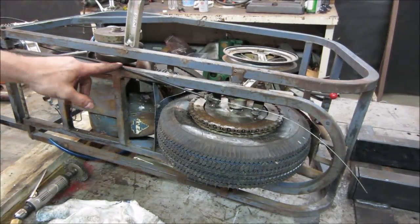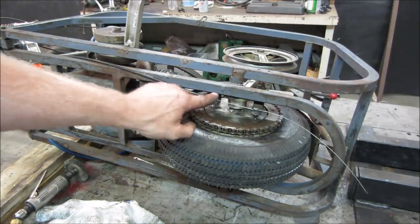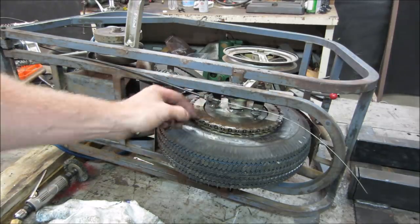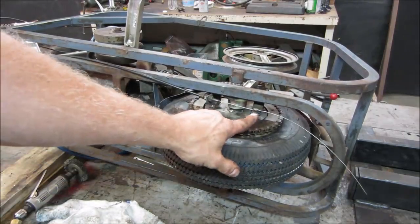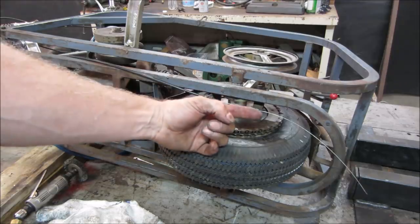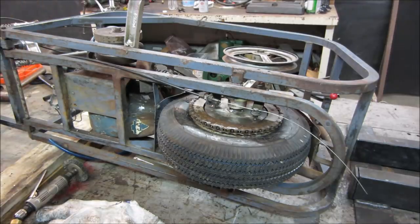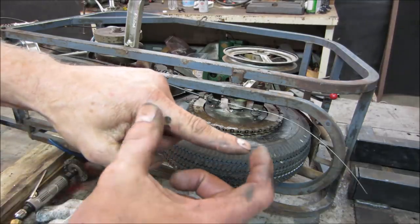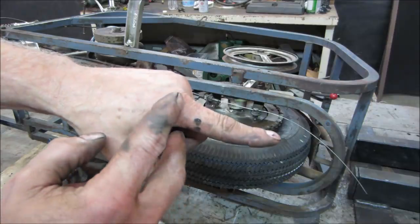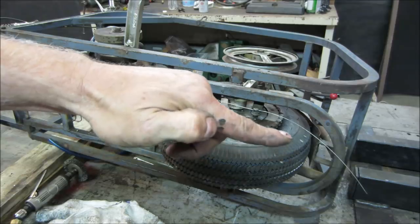Yes, I just used the same jacket over again, same adjuster. It's all the way in, so over time I could just crank this whole assembly out and it'll get tighter. It's got, I don't know, half inch of play for it, and it's a pinch on this side. It just pinches the cable, hole goes through a bolt, and you draw the bolt down, it pinches on the cable. On the other end, I left the nipple on there, and I actually drilled a little hole in the handlebar. So I fed on the top side, it does the same thing, but with a bolt with a pinch hole in it, I let it come through, and then on the back side is a nub from the cable that can't pull through.